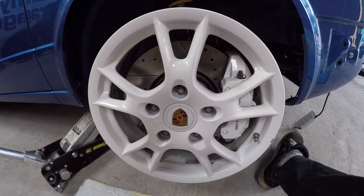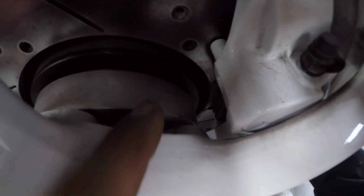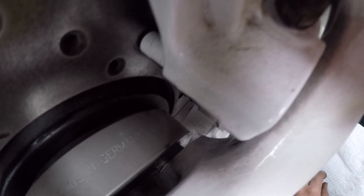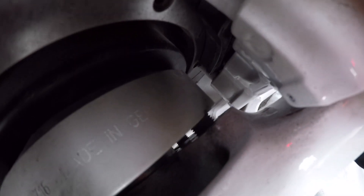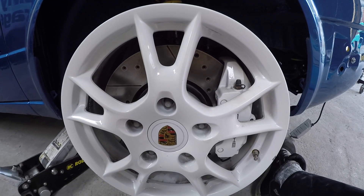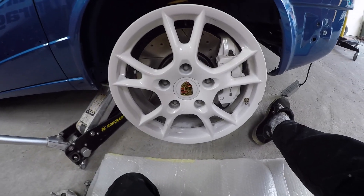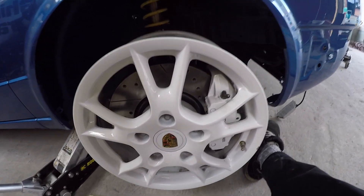Okay, as you can see, they hit the brake calipers. Still got some space over there — I don't know if you can see it correctly. Like this you can see it. So on these adapters they hit. I think I need about 10 millimeters or something like that — bigger spacers. That's a problem for now because I only have these ones and some smaller ones.